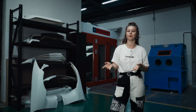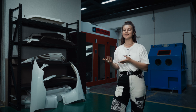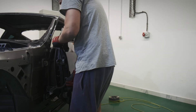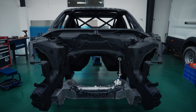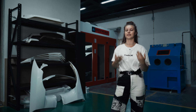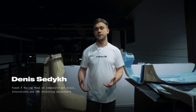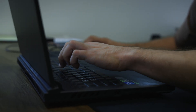Developing a body kit is not just about pouring material into a mold — it's a precision engineering, complex, multi-step process. We started with 3D scanning of both the 370Z and 400Z platforms and discovered they have different door panels, rear fenders, and headlight installation points, all of which must be accounted for in the 3D model. After the 3D model is complete, we move to installation and production. Once we receive 3D models from the design team, we prepare CNC programs.